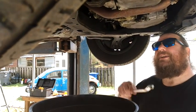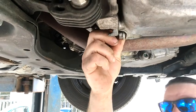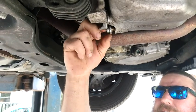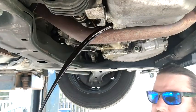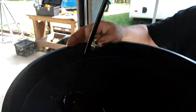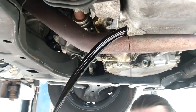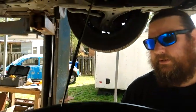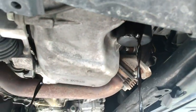I've got a nice big drain pan so it'll catch all these fluids. Try to gauge yourself a little bit because it's going to jump out — it's not going to come straight down, so if you're not ready for it you'll make a big mess. I've always been told don't sit there and watch the oil drain, so find something to do. Scoot it over a little bit and break loose the oil filter — get that started draining, crack that one loose at the same time.